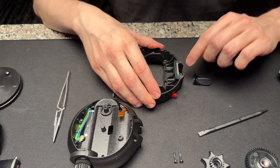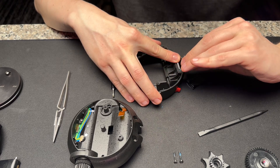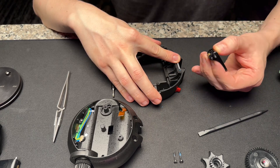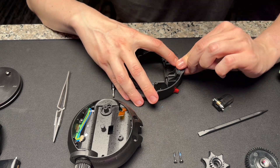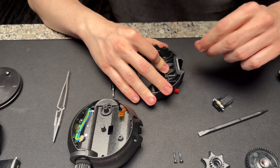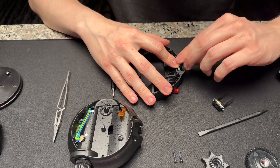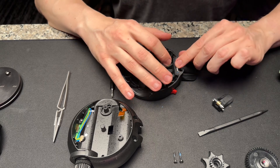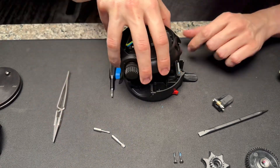There's this metal part, and behind it there's a spring that usually pops out. The actual locking mechanism — the plastic piece — just slides out like that. This is what breaks all the time. It should be together, obviously, and it just breaks because there's too much tension in this unit. The flap sits in here, and the flap spring is literally just sitting in the backside of it, pressing against this part of the plastic. Now I can install the new latch — it literally just slides in and gives you the ability to lock and close it.